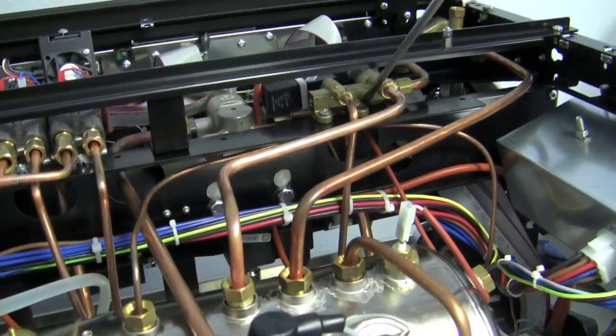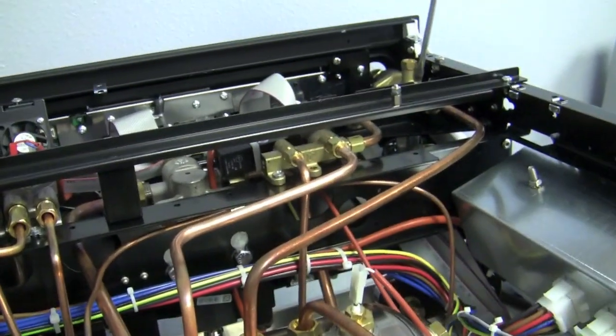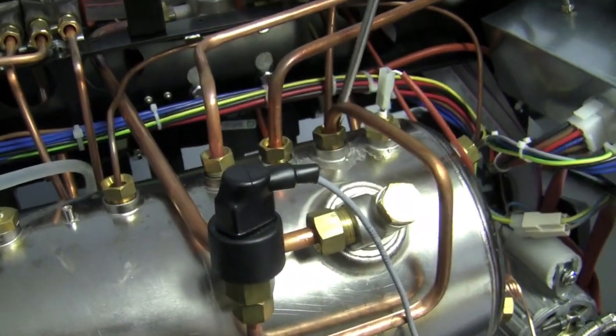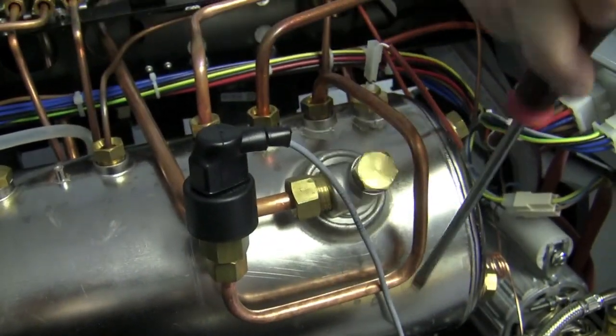So this is a block for a hot water valve — and we'll get to it again, but that's cold water coming in, and this is hot water. This is the matching steam arm that goes out. This right here is our electronic pressure stat. This machine allows you to set the pressure of your boiler directly by electronics right at the front of the board.